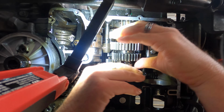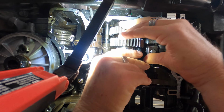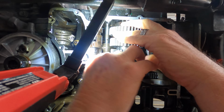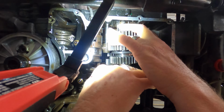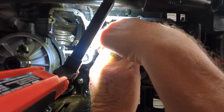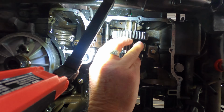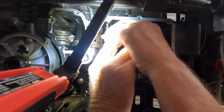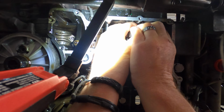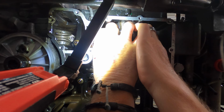Okay, so what I've done is I've taken the first gear in line off up this end, just to be sure that with the washer swap we can get it started in the bearing, and second gear can get past this gear at the front. But I'm starting to be concerned that we may not be able to do a washer swap on this particular bike. The clearances may not allow it. We might have a stack tolerance issue.